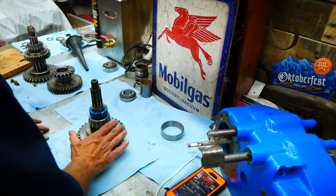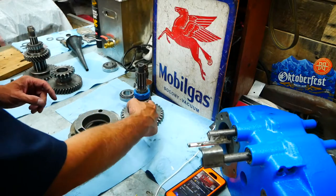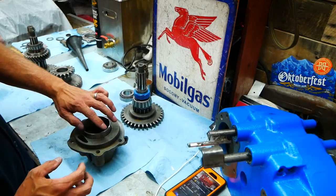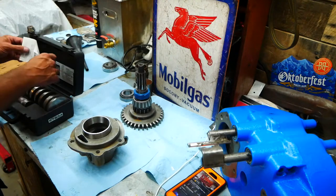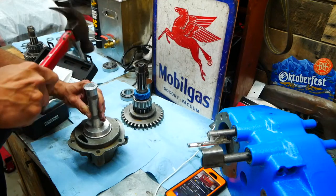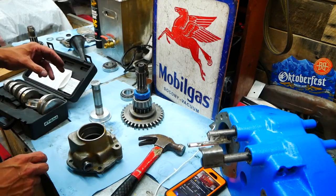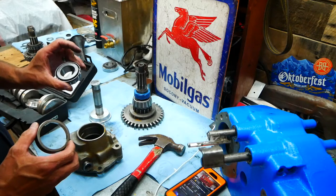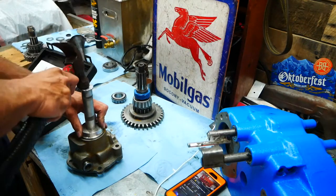That's as far as we're going to go on this particular buildup because we need to put the races into the cup. We're going to take the rear output shaft housing and put the race that goes to this bearing in here as well — it's going to go on the back side, on the inside facing out. Let's go ahead and pound this in. In order to drive this in we are going to use a seal driver. Make sure you have it flush and it's going in even. We are in all the way. Now we're going to flip it over and put this second race in as well — race 15245, bearing 15117.